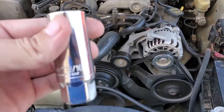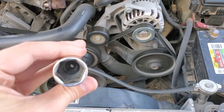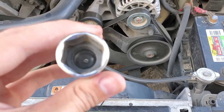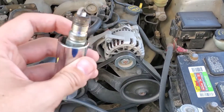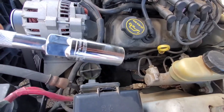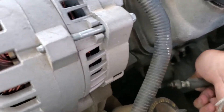While he's installing that, I want to show you guys a nice little trick. This is a 13/16ths spark plug socket. The ones we are working on are 5/8ths sockets. The reason they are spark plug-specific sockets is because, one, it is a six-point only — these only come in six-point. And then down in the very bottom of it, you can see that little rubber grommet. What it does is it essentially grabs a hold of the very top of the spark plug so that whenever you pull it out, it doesn't go anywhere. But a neat trick for if you're in a pinch or if you don't necessarily have one at the moment, you can go ahead and loosen the spark plug with a typical deep-set 5/8ths socket. And then after you've almost got it loosened all the way, you can put the spark plug wire back on the spark plug and be able to pull it right out.